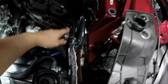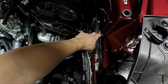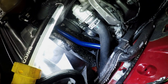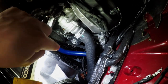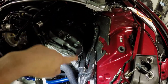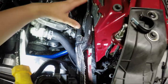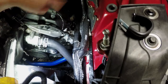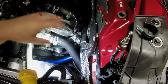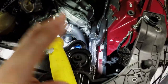As you can see, we have the line that feeds from the oil cooler up front, and this is the line that feeds from the accu-sump in the back. The missing feed line will go down onto the subframe. This runs from the OEM output of the oil filter housing. There was nowhere I felt comfortable running the accu-sump line that wasn't near headers — anywhere else would require interacting with the subframe and getting close to headers. So I stuck with this tried-and-true method. I have a lot more confidence in this setup.